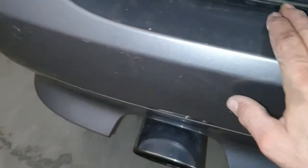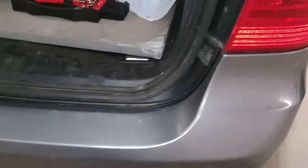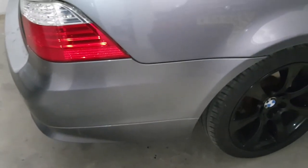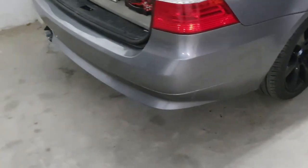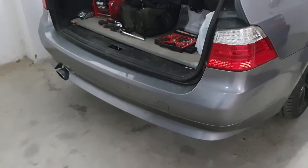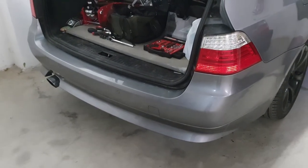When reinstating your bumper, the side bits you can see where they line up around the boot area — just make sure you go underneath the black clip all the way across. They position relatively easily, then just fasten your screws back in. Get it all lined up nice and neat, secure it back in with the bolts, and that's it — job done. Thanks for watching.